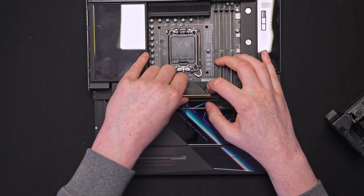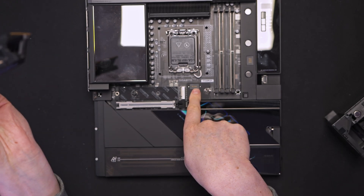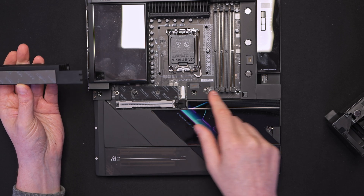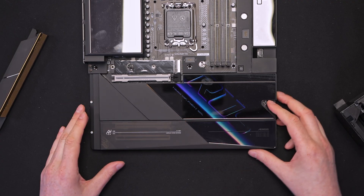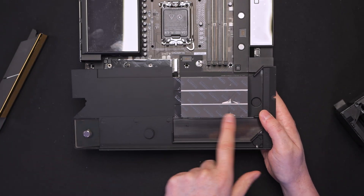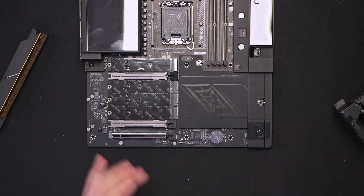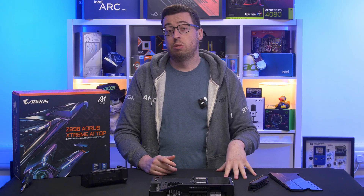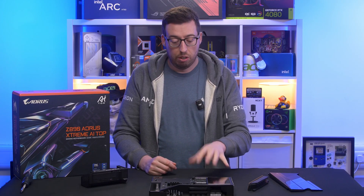Going down to our expansion slots — the first one here has a massive chunky heatsink with a nice gold side on that as well. There are push pins on the underside that go to the board and also shine through with RGB. Up to 110mm Gen 5 drive there and you've also got a nice little quick release for the M.2 drive. Now this big panel at the bottom is also removable — comes off in one big piece. Turning that around we've got another three 110mm thermal pads, magnets on the other side, and support for another three 110mm NVMe drives. The top one is going to be Gen 4 off the CPU then the other two are going to be Gen 4 off the chipset. I really like that configuration — much like a lot of the ASRock boards — so you can use all of the lanes without your top graphics card slot suddenly dropping to X8 the second you put another drive in.